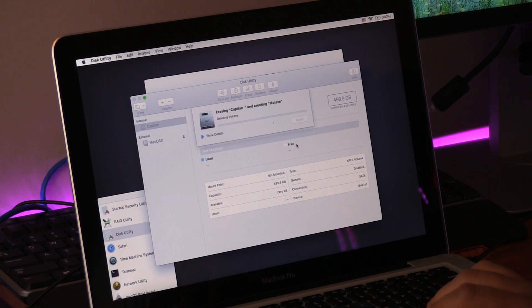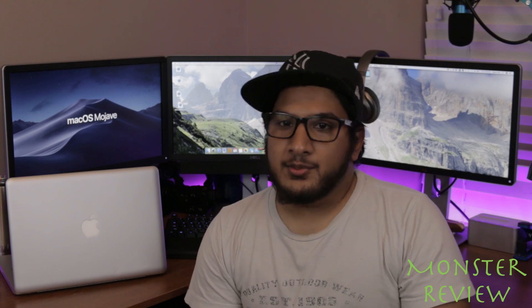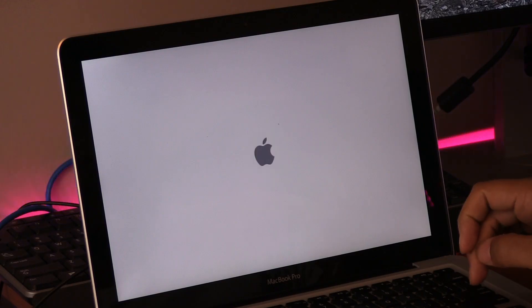In the bottom left there is a utility window — click on it. We need to reformat your hard drive; format it as macOS Journaled. After the format is completed, reboot your Mac, and once again hold down the Option key and boot into your flash drive.